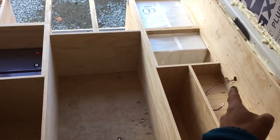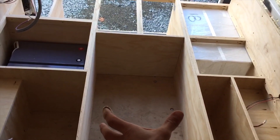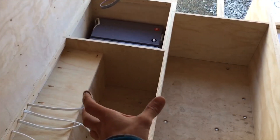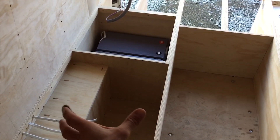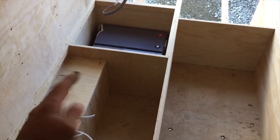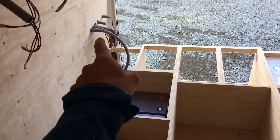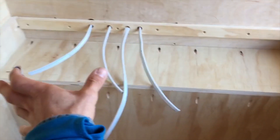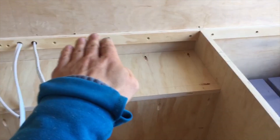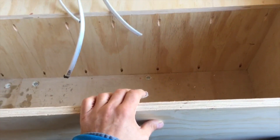450mm is the distance between the outside wall and the front part so that's going to be the width of our seats. This opening here is 600mm — it's a nice area to walk but most likely you won't be walking; that'll be where our table goes. Over here is about 650mm and we're taking 450 to make this side even with the other side. The remainder I will build above and that's what's going to contain our squishy panel with the fold-down table and our shelves at the back. The inverter will sit here and that leaves the remainder of this box for whatever storage we want — I think that's going to be where backpacks go.